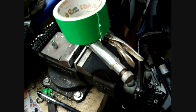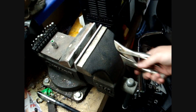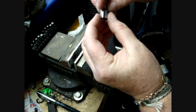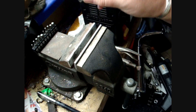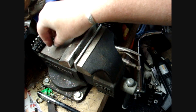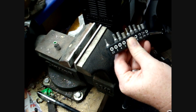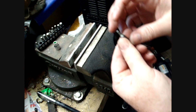What I ended up using was my bench vise. To break a chain without a store-bought chain break, you're going to need these basic tools: duct tape, a pair of vise grips, a bench vise, a 5mm socket — you could use a 4.5mm, I chose to go this size. And what you'll need is one of these little hex drivers that work with sockets. The 3 is perfect.